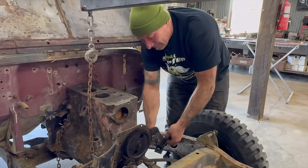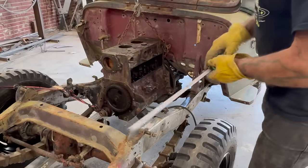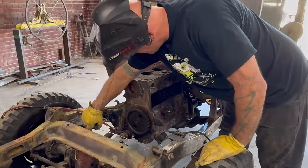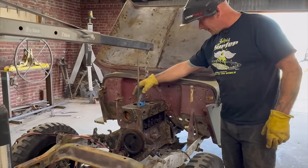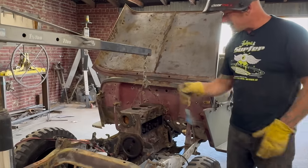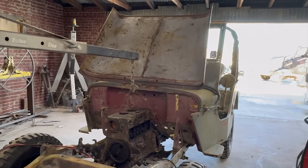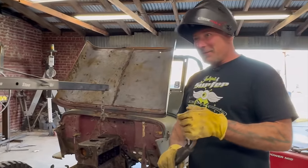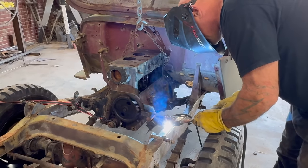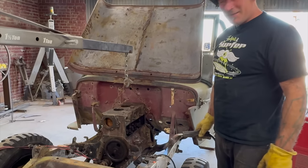Sweet! I gotta say that was incredibly satisfying to watch. They make a tool for every job. Cool — so I'm gonna tack this in place after checking the 13-inch again, do the same on the other side. One last check on things — we're going at 13, and this is still level. I know the Jeep itself may not be level — we could always put a little washer in there. It's not gonna matter — the Jeep is made to run practically upside down. The engine being a little degree off — it's not gonna matter. That's a heck of a tack that I committed.